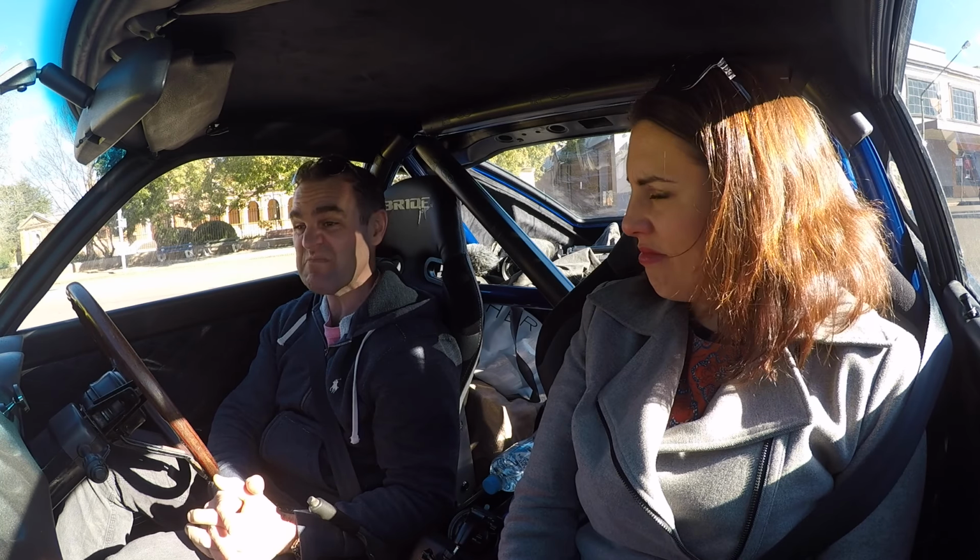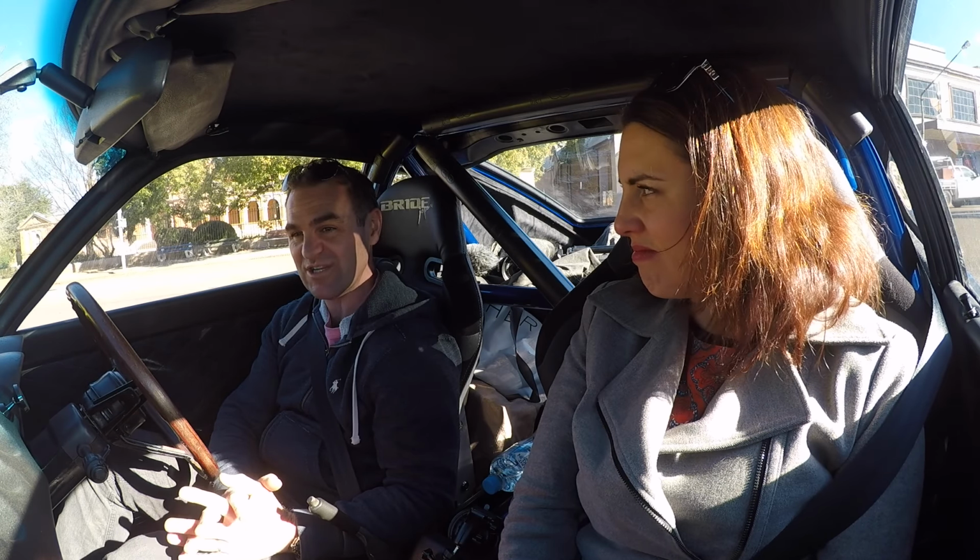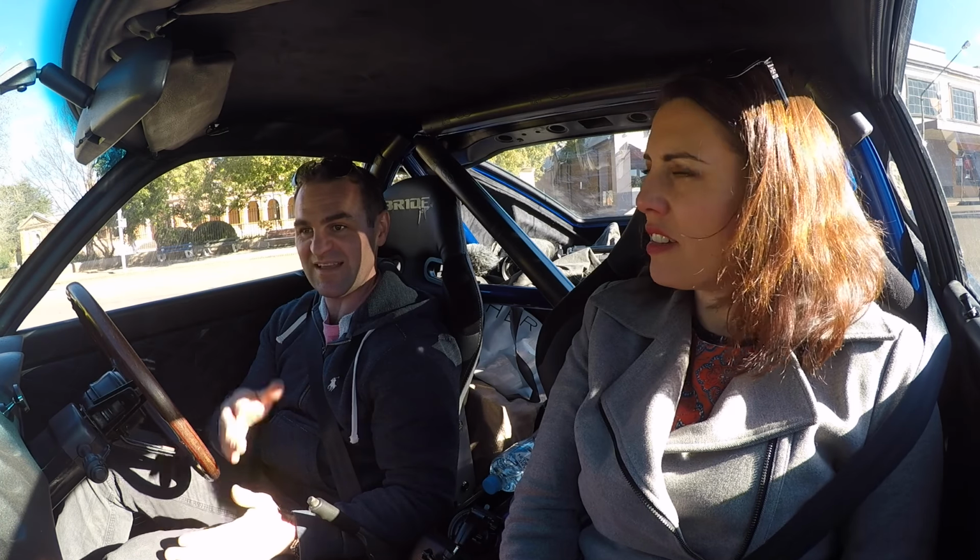Alright, that is 1 hour down. The car is, how'd you find it? Loud. It's very loud, particularly at 110 on the freeway. It's loud and smelly. Yeah, the battery I think is overcharging, so that's not a good thing, and we can smell the battery acid, so that's not great. That never enhances a car journey. No. Nobody ever wants to smell battery acid. And the seals, I know I mentioned the Bailey channel, and I'm pretty sure that's the main thing, I'm just getting buffeted by wind noise at that sort of speed.